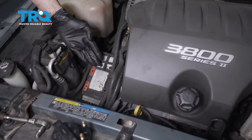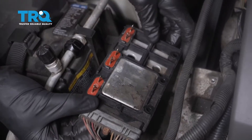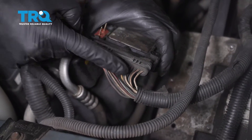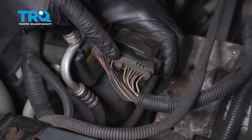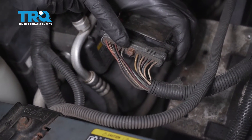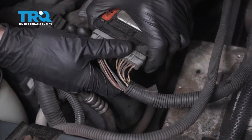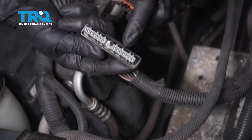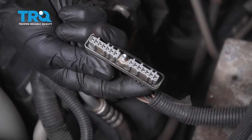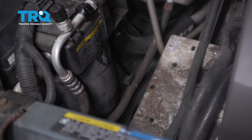With all the coils off of the control module here, you can carefully grab onto it and we're gonna carefully lift it up and off. Now the next thing you wanna do is get ready to dismount the electrical wiring harness that leads to it. To do that, I'm gonna go ahead and remove this bolt right here using a 7-millimeter. Slide that off of there. You wanna give your wiring harness a quick inspection, make sure you don't see any corrosion. That looks good. There it is, friends.